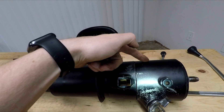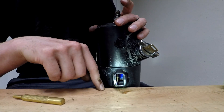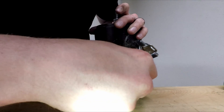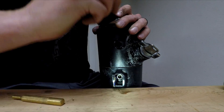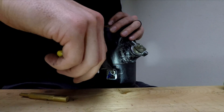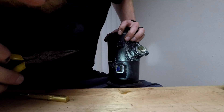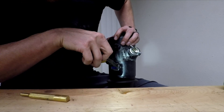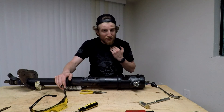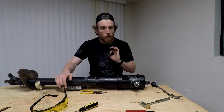Because if the spring falls back there, it's going to get stuck in this mechanism — or you might be able to get it out this way. I forgot to mention a very important tool, which would be gravity — that definitely helps. If you can take your column out of your truck, do it. Now we're in the hole, we can take our cardboard out and toss it. Seriously, if you can pull this out of your truck and do it standing upright, that would be the best.